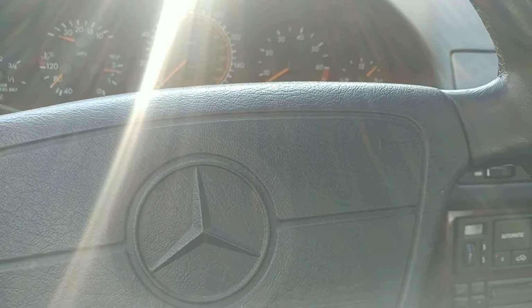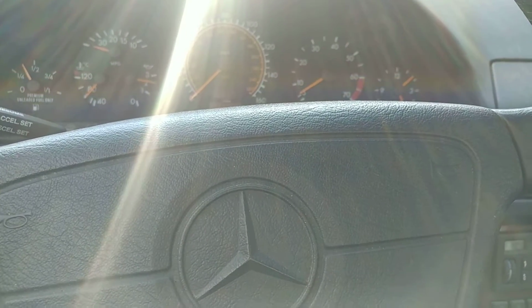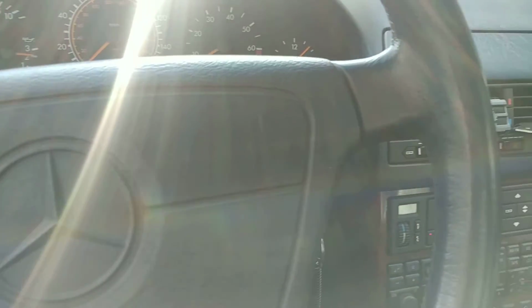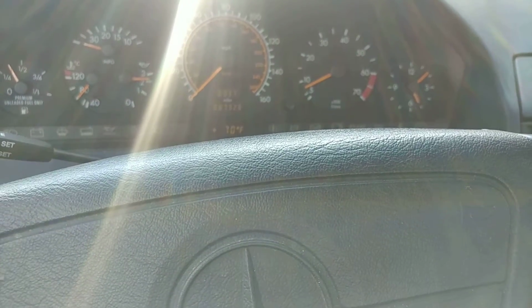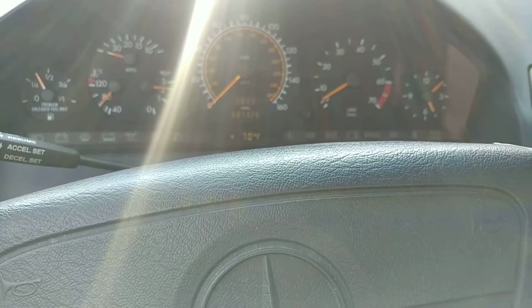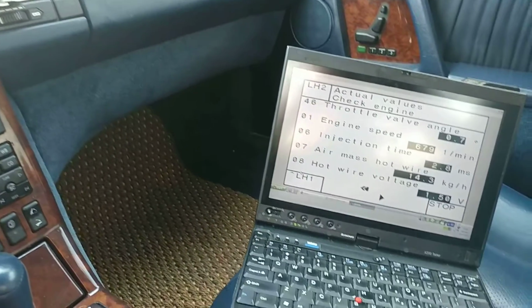When the car is in drive, you basically barely feel the engine. It's very smooth actually. Well, engine mounts and transmission mounts, they're a little tired, but not critical by any means. Very good. Neutral, reverse. Reverse is on the weak side because these transmissions are known to fail in reverse, unfortunately, but that's the way these are. So usually you would want to warm it up before you drive. I would suggest warming the whole engine and transmission, so they're warm before you go.